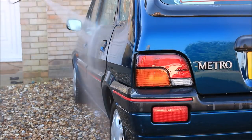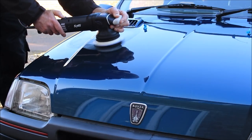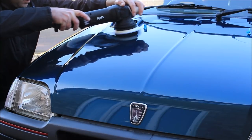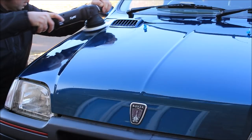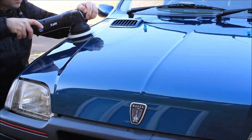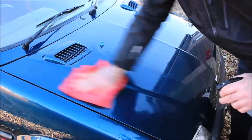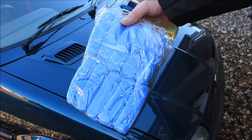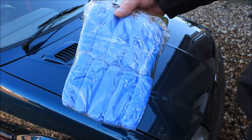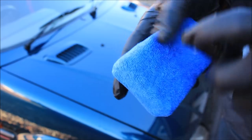So once I did all this, I dried the car off, moved around to the front again, and then machined the bonnet with some final finish polish from Menzerna — not an aggressive polish. Just enough to get a nice flat surface, there's nothing in the paint. It's been polished before — you can check that video out. There's an alcohol wipe-down, IPA solution, about 40% in there. Give this time to flash off — really important. Brand new applicator pads — pre-spray it. Getting nice and close, quite breezy today, got that blowing everywhere. Smells nice as well, this stuff.